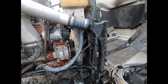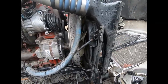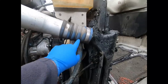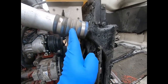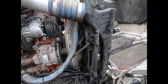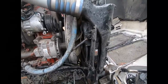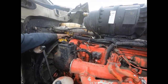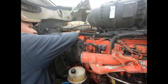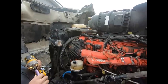We're over here on the passenger side of the truck and we've run into some clearance issues. I was thinking we were going to get away without doing it, but we're going to disconnect this radiator support on the passenger side and pull part of this charge air pipe off to lean the radiator just a little bit. We can almost make it, but just not quite — it's easier to do that than it is to be busting stuff up. We also discovered we've got to move that little clamp on that radiator pipe to free it up so the radiator can lean ahead. Half-inch nuts on the clamp.